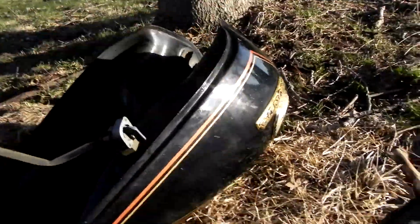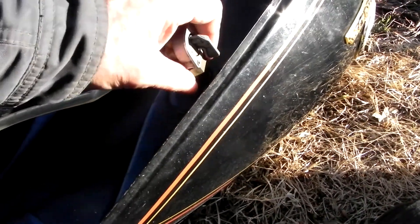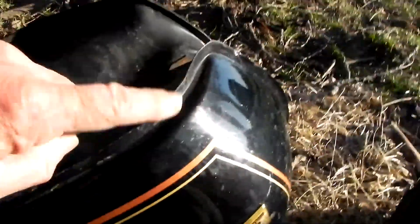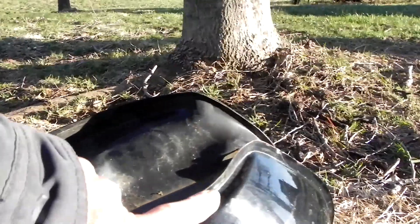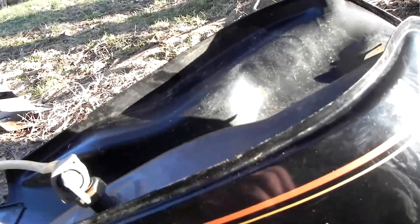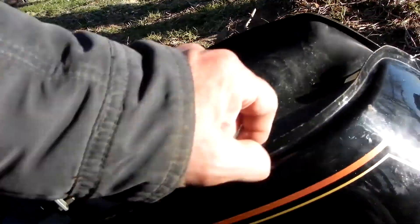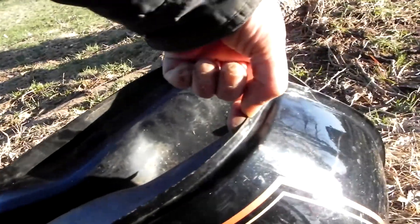Here's my gas tank. This is a drain hose. I'm going to have to take the petcock off because I don't want that acid inside the petcock, and I have to clean this anyway and inspect it. See that rust? All that rust there? I'm going to have to sand the bottom of this tank off and then repaint the whole bottom and this whole ridge. I don't know if there's a chrome thing that goes over it, but I'm going to need to paint this anyway. So I'm going to sand down the edge and feather these down and get the rust spots out right here.